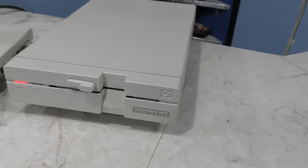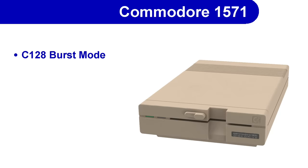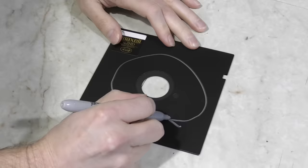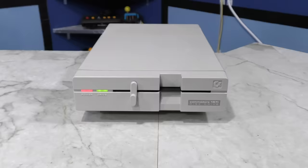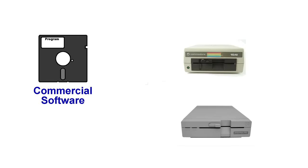In 1985, with the introduction of the Commodore 128, Commodore also introduced a new drive to match called the 1571. Besides having a very different visual appearance, the 1571 also added many new features. It supported the C128's burst mode, which meant it could finally transfer data at a really high speed. It also had 2 heads, so that it could read both sides of the disk without having to flip it over. When formatted, a blank disk would have 1328 blocks free — twice what the 1541 had. However, being that most commercial software wanted to target the 1541 for the widest compatibility, virtually no software was ever distributed on disks formatted for both sides, even software designed for the Commodore 128, because some 128 users were still using 1541 drives and never upgraded.